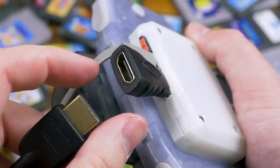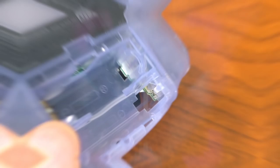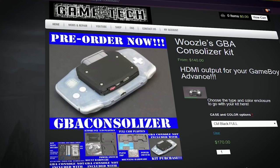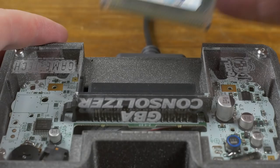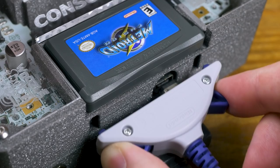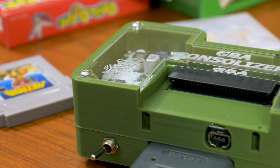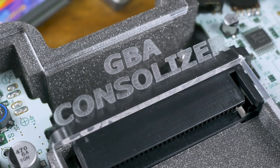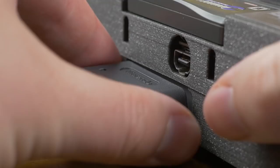We found many full-sized to mini-sized HDMI adapters to be rather touchy, so we suggest using a relatively lightweight cable that has the mini-sized HDMI port. Unfortunately, you cannot use batteries in these modded systems. Currently, Game Tech is selling the basic kit with the original GBA body for $140 and the enclosure kits for $30 more. If you want the cheaper one, select 'black LCD' from the drop-down menu. The enclosure has hooks and connections for GameCube and GBA link cables, plus access to the headphone jack. Be careful with the plexiglass cover, as cleaning it with isopropyl alcohol will cause it to crack. Also, the SNES controller socket holds controllers pretty tightly, so be gentle.